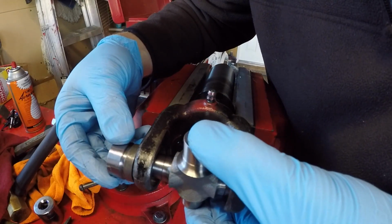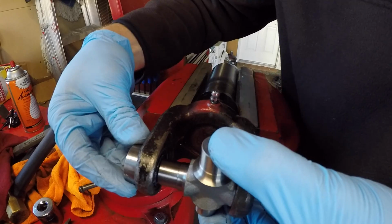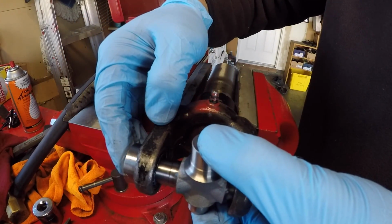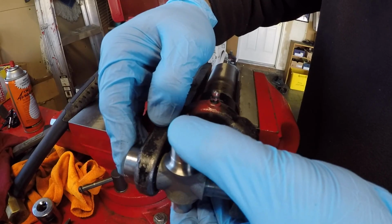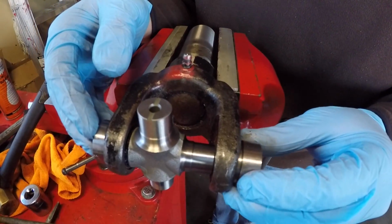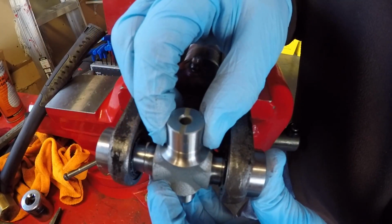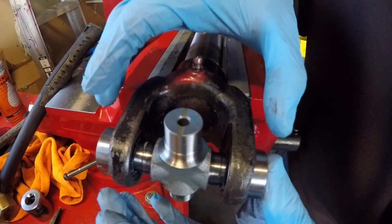So we're going to start it on one side, back the trunnion away, push this in a little bit. See, there's a relief. Now it's starting to actually have a little bit of friction. And then I'm going to put this in carefully. There we go. Now same thing here. Get it started, and then there we go. See, it's moving freely, which means it has some contact with both sets of needle bearings.